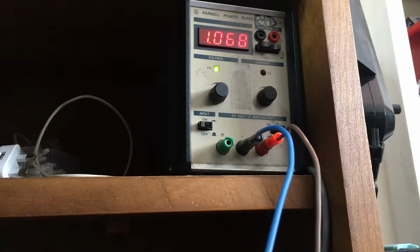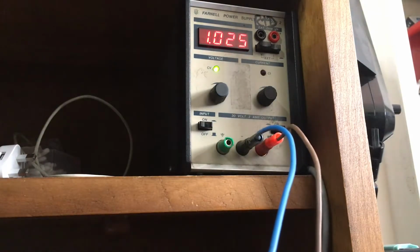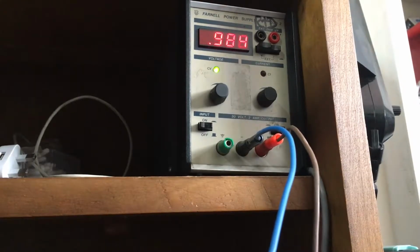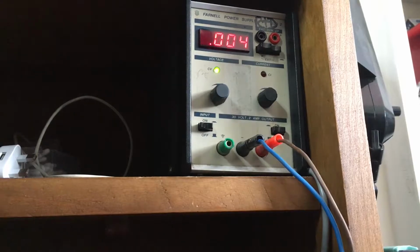See, look, it's taking an amp now, but it's not clipping. That's probably because the battery's just sprung back to life. I've never seen this actually. Normally, it'll just clip, clip, clip. Give it 30 seconds, check the voltage, clip, clip, clip. So there you go. I'll give it a few more seconds, and we'll come back to the battery.